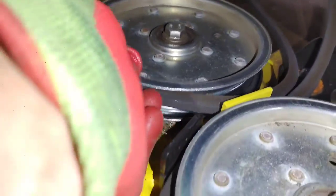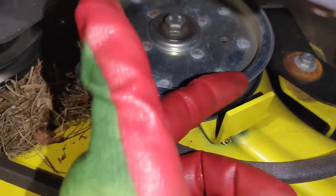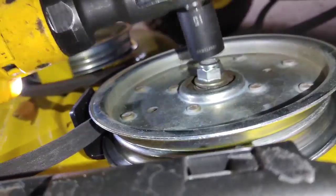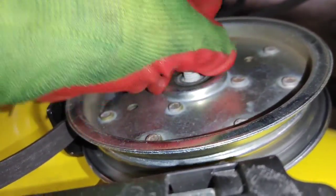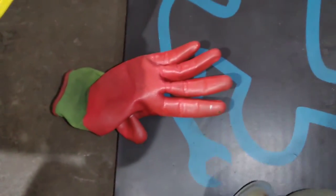Real quick, I'm going to check these idlers. I'm going to pull this belt away. You should not be able to pull this belt out between that yellow guide right there. But that one's bent, and this idler does not sound good. You shouldn't be able to pull that belt through there — it should not slip through there, so that thing's bent back. This other one is the tensioner idler — it's the same part as the other one. A lot of times you can feel the bearings with your finger. I'm going to take it off and spin it to see how the bearings feel. This one ended up being fine — felt really good, no issues, no noise, nothing.